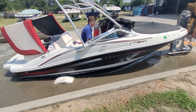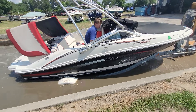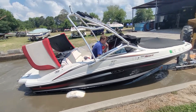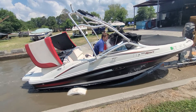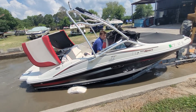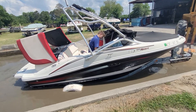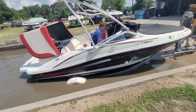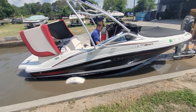A little boggy on the power-up — of course it is a 3.0, and depending on what propeller is on it, could be a little too much pitch. Somebody trying to get speed puts the wrong props on. RPMs usually turn about 2,400 to 3,200 in the tank without it moving. Once the boat's moving the RPMs will come up. Sounds good — it didn't die when you got off of it.